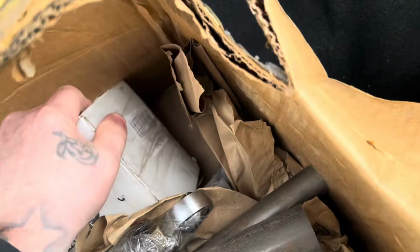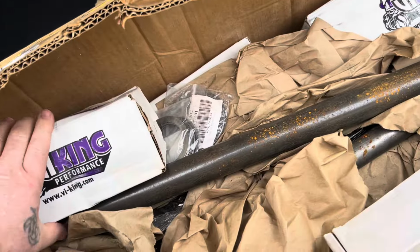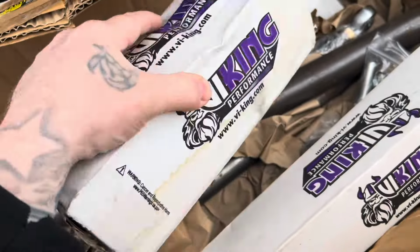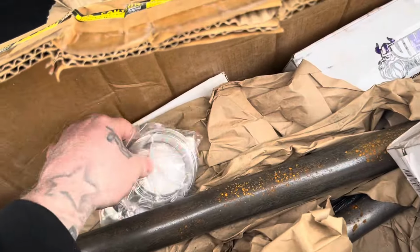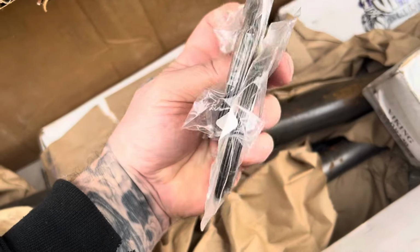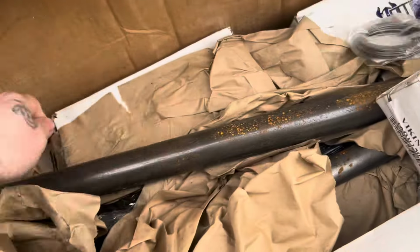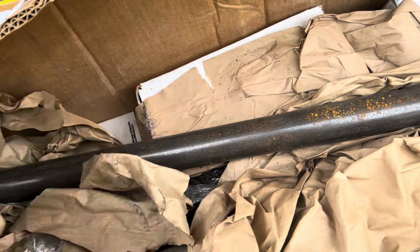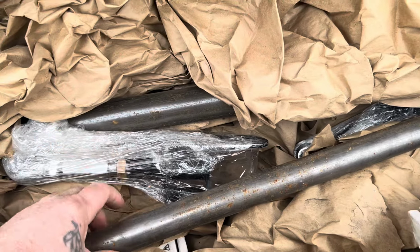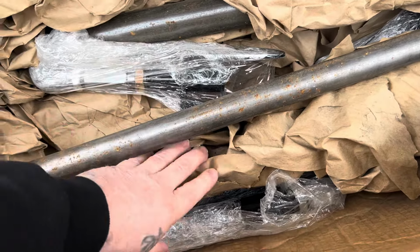Let's see what this one is. This is a 550. This car got a 307 in it. Obviously, I got a 10-inch 250 spring to the back. Got the thrust bearings. Gotta have the thrust bearings on the front. 100% on the front. Got to. Don't be cheap. Got the cross brace. Rear end brace, which now I've been using bigger ones, so I'll do that bigger.